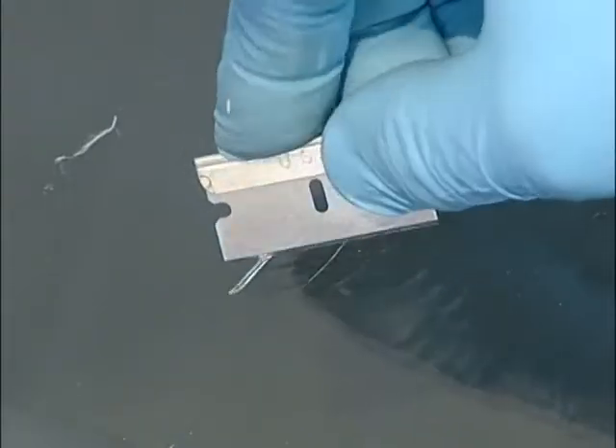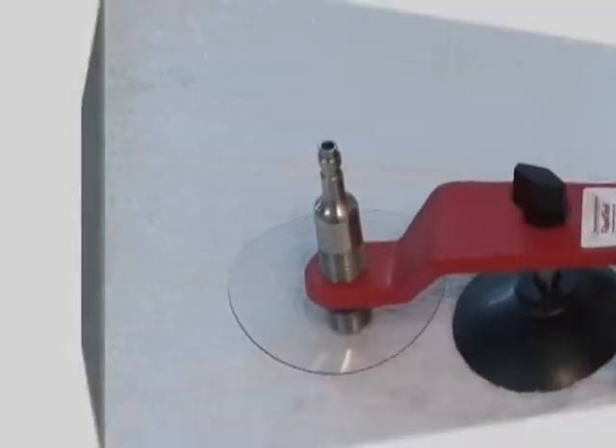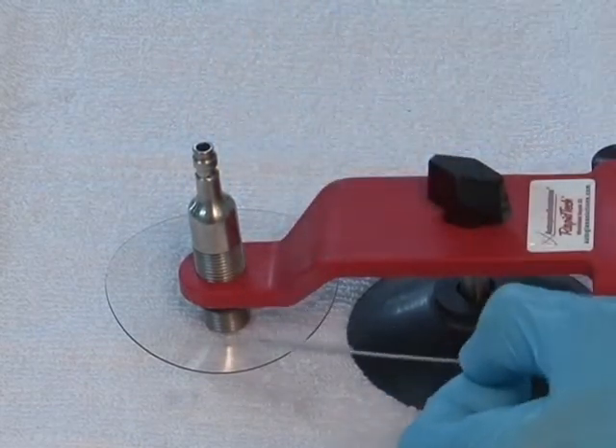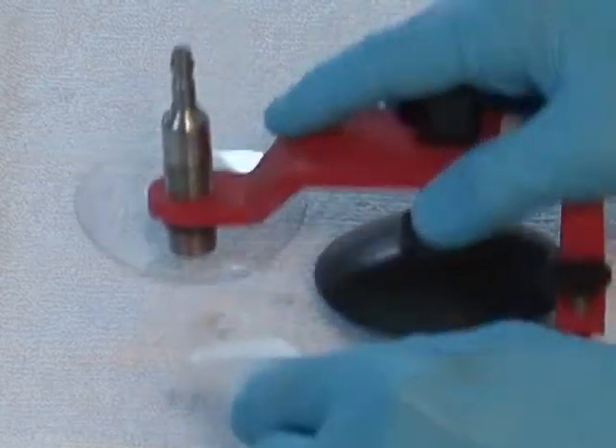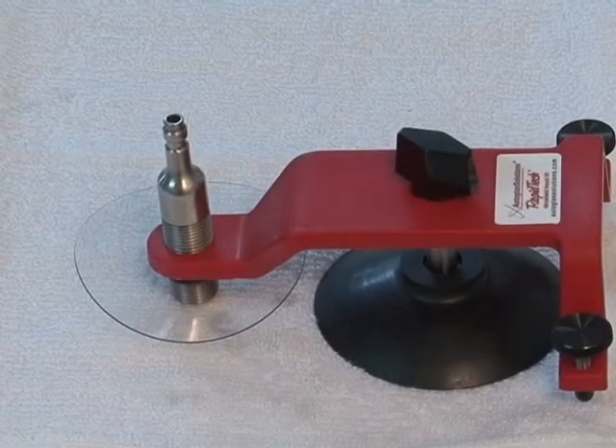Remove the cure tab. Using a new razor blade, scrape the cured resin in a back and forth and up and down motion, until the resin is level with the surface of the glass. Apply a small amount of pit polish and vigorously rub with a cloth until the resin is shiny. Clean the windshield with glass cleaner. Use the brush to clean out the injector chamber and clean any resin off the injector bridge with cleaning solution. Proper cleaning will prevent contamination on the next repair.